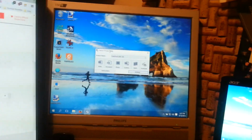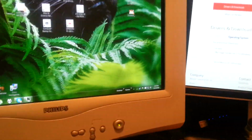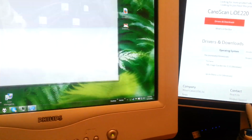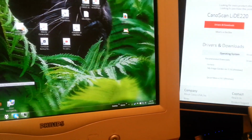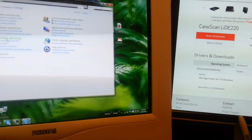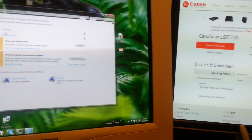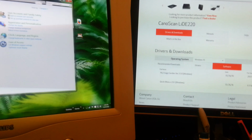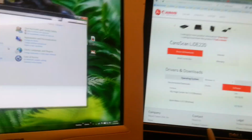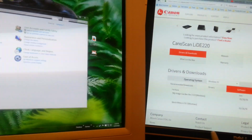Second thing, a lot of people don't know about, is the USB power saving in Windows. I'll just do it on this machine. It's in your device manager. What Windows power saving does is Windows looks at the USB ports, and anything that it thinks is just idling, it shuts the power off. But the problem is that often it means that device won't wake back up again.